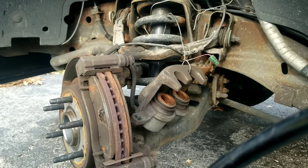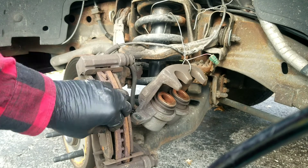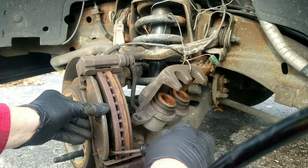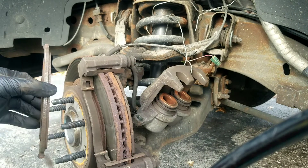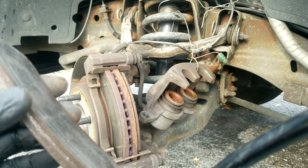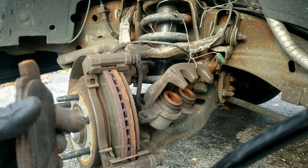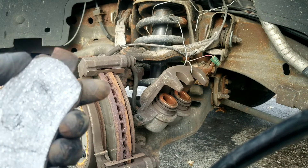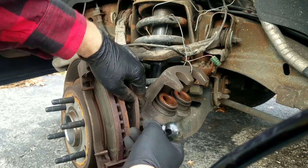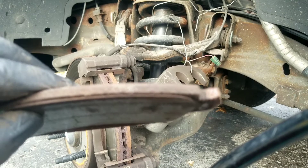From this point you can pull the brake pads out with your hand, or use a flathead screwdriver to get behind them — it's that simple. As you can see, I got just about maximum life out of these. My other side might be rubbing metal to metal — that pad looks pretty thin. Same thing on the other side: stick the screwdriver in and pry away from the brake rotor; they slide right out. Yeah, it doesn't get much thinner than that.